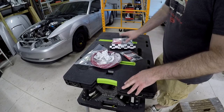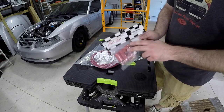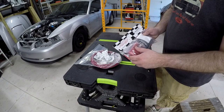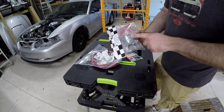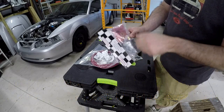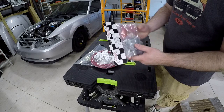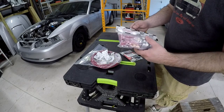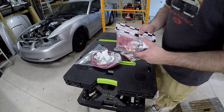Here's the actual battery disconnect mechanism itself. This kit came from a company called Fastronix — I ordered it from Amazon and I'll link everything in the description. This kit is really nice. It comes with the battery disconnect itself, some new copper lugs to make your new battery cables, and also some protective caps so you don't have to worry about arcing anything. They're 2 gauge in size, which happens to be the same size as my positive battery cable. So we're pretty much just going to run this in line with the positive battery cable from the battery to this.